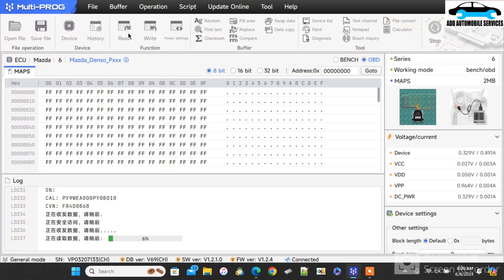After reading in OBD mode, we also read the bench mode, then we do some VIN editing so that we can see how best to use this tool. With the VIN editing it will affect the file itself, so when you put it on the vehicle, you just read the VIN that you've edited onto it.